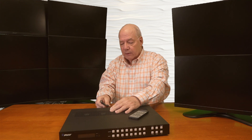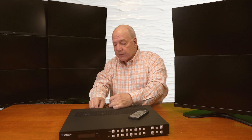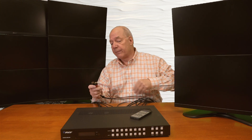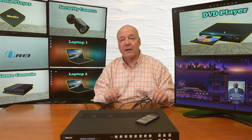I've connected 6 cables to the monitors over here which I'll plug into HDMI outputs 1 through 6. If you're using this in video matrix mode, it doesn't really matter which monitor you plug into which output because you can easily move the inputs across the outputs as needed. However, if you're using it as a video wall generator, it's important you organize the monitors correctly and plug them into the right output ports. I've already plugged in the power supply - the other end has a barrel connection with a locking collar which plugs into the DC input port. The minute I add power to this unit it immediately starts an internal power on self-test, the fans spin up, and it takes a second or two for that self-test to finish. You'll hear a beep when that's done - and there are your outputs.